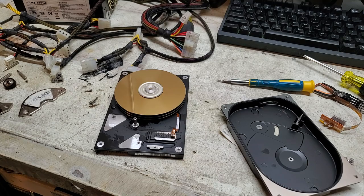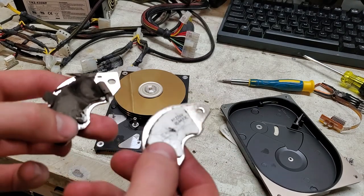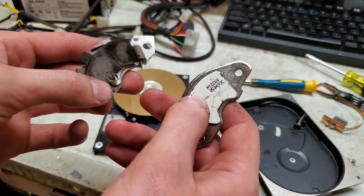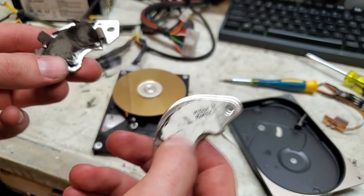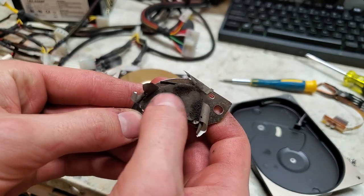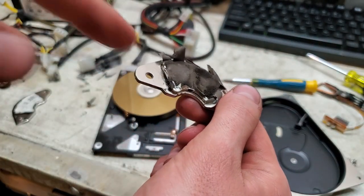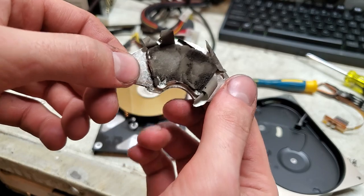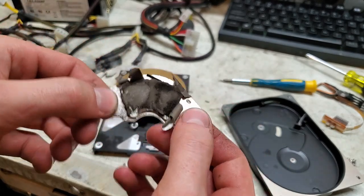So I was about ready to just tuck this thing in the trash, but then I pried apart the voice coil magnets. You'll see that they're somewhat covered with a coating on them. This one I pried open with a screwdriver — this one over here did not tear or rip in any way; it just scratched as if it was just a magnet underneath. However, when I pried it apart, this one burst open and there's what appears to be like an iron powder — or maybe that's part of the magnet. It appears that it has leaked outside of this casing, because I saw a bit of this stuff in between the magnets. I think that leaked in between the magnets and jammed up the voice coil, so it couldn't move. That's why it was making the buzzing noise trying to free itself.